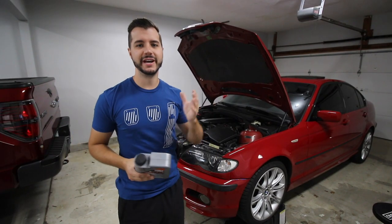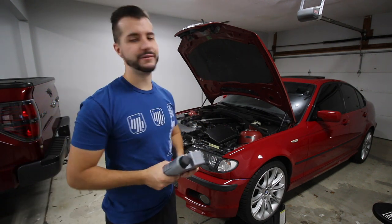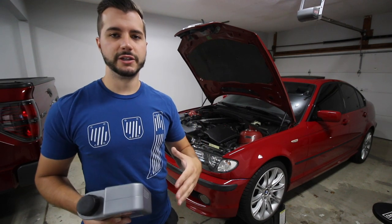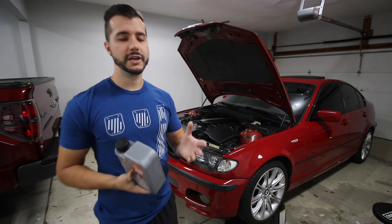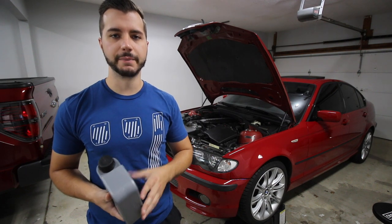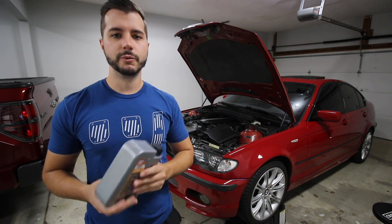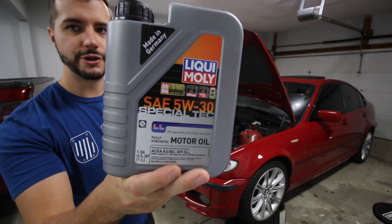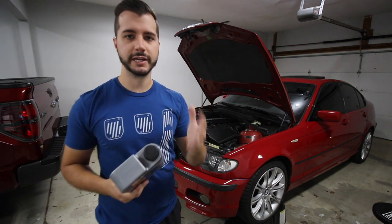What's going on guys? I'm coming at you with yet another BMW E46 video. It's time for the first oil change. Normally when I buy a used car, one of the first things I do is change the oil and any other fluids that might need to be flushed. But the previous owner had such good records and printouts of taking it to a shop I was familiar with, so I drove the car around several thousand miles without getting an oil change right away. We are doing the 5W30 Liqui Moly oil — historically this car has had 5W30, so I'd like to keep the same weight.